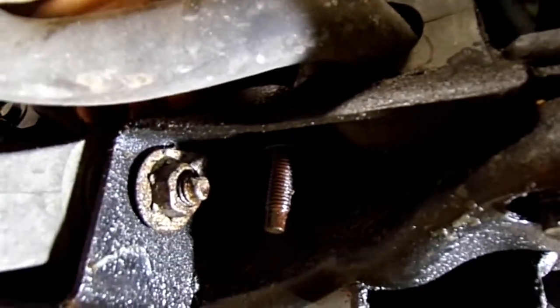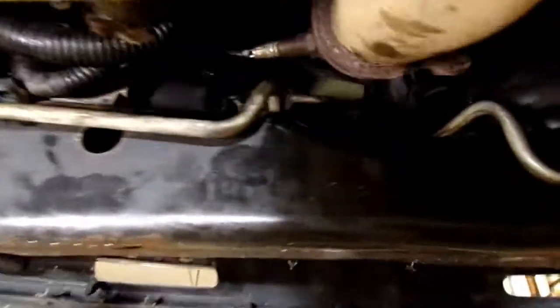Now on that power steering line, I'm on the driver's side here, that runs on top of this subframe rail. And we won't be able to see it. You'll have to feel for it through here, but there's a plastic loop clip on it that has to be undone. Okay, on the front side of this line, right here's the line. I'm trying to get a light here in place where you can see it. There's a clip here that clips that line in. You just need to pop that up. That's that line free here up front. This is up on the front subframe.